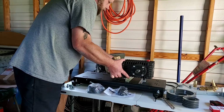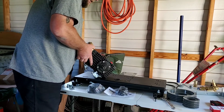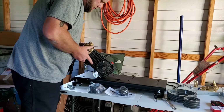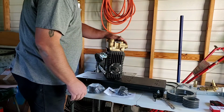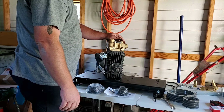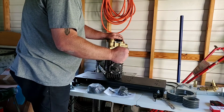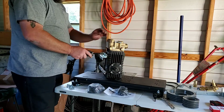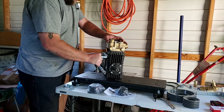So to make this right, and it does weigh a little bit. It's a TSF 2021, by the way, at 3400 RPM. It's supposed to be right at around 8.5 to 8.8 gallons a minute. And this is kind of a trial and error thing too.